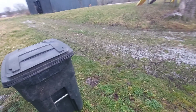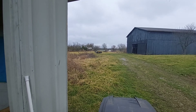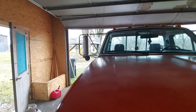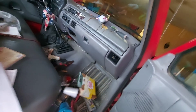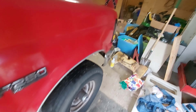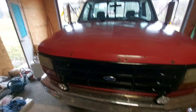I'm gonna start cleaning on my interior. But first, since it's still light outside, I'll finish greasing my front end and then go move that trailer and put that stuff in the barn. All my steering components are greased down there. If you guys know anything about OBS Ford, a lot of people talk trash on the twin traction beam front ends, but most of the people that talk trash on them don't take care of them. Twin traction beams are a little more difficult to upkeep than a solid front axle, but they ride better and you get better flex. I'm not straight axle swapping this truck.